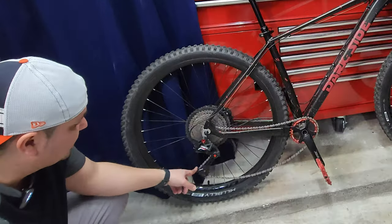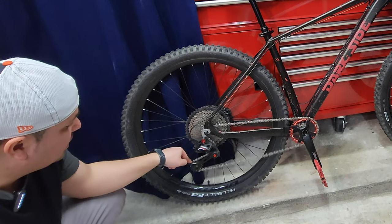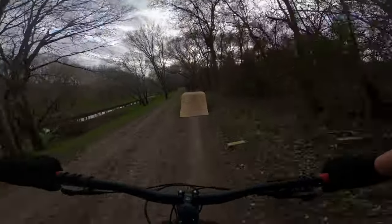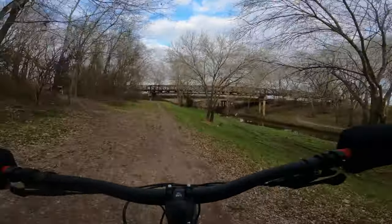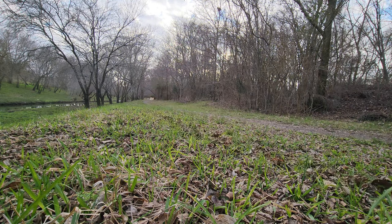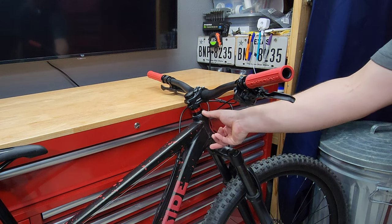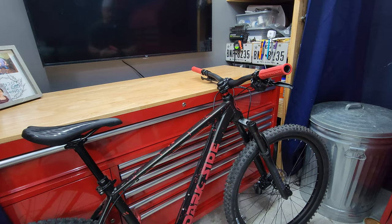The derailleur has an adjustment for a clutch-type setting — small, medium, and hard — which makes chain tension harder depending on the setting. Stock saddle for now. 29-inch wheels, not tubeless — tubeless ready, but my dad doesn't want that setup. Up front I have a Wake handlebar, 780mm, 31.8mm clamp diameter, with a JG Bike short stem at 35mm center-to-center, and a Zito headset 44-to-56. Grips are Race Face Chester Half Nelsons.